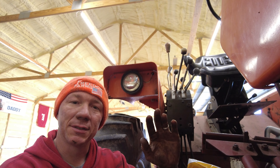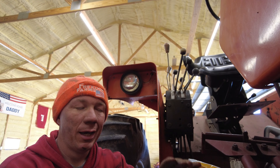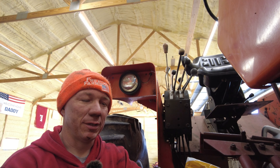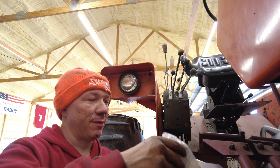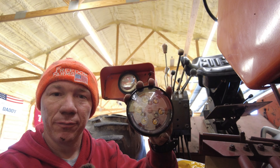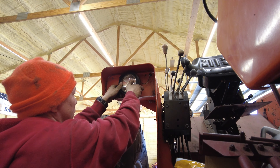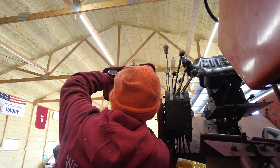You guys know me and my fascination with lighting. I just can't stand halogen lights — they've come leaps and bounds since the first incandescent light bulb, however LEDs are just unsurpassed. So I bought some PAR 36 bulbs to simply keep the same housing, still maintain the high and low beams, and literally just pop these in to replace the halogen right here behind me. These are pretty simple — all you do is just pull on the rubber seal around it and it'll come out. Hopefully your seal's not dry rotted.